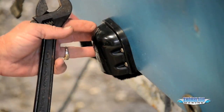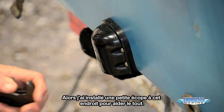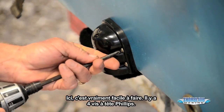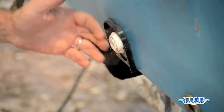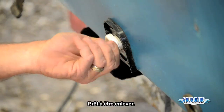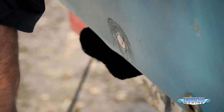On my assembly, we've got a scoop on the back — it's a low water pickup. With boats that have the live well pumps coming straight out of the back when you're up on plane, they won't pick up because there's no water on the back. I've installed a little scoop on there to help that out. A lot of them have just screens on the back; you'll have to remove the scoop or the screen to get to it. On this assembly it's really easy — four Phillips head screws and it comes right off. Little twist, pull the nut off. Usually take your wrench and give it a couple taps and your pump's out, ready to go.